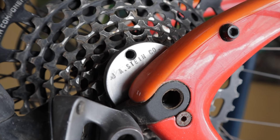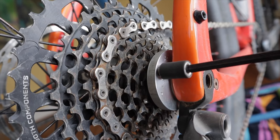Once that's all sorted, make sure the wheel is installed and tightened properly — the tool needs to sit flush and engage the splines evenly. Spin the wheel to rotate the tool until you line up where you'll want the pin to contact the frame. Make sure the pin's not going to rest on the derailleur hanger or else you can shear it off and really mess things up. The optimal position varied between my two bikes, so it'll probably be different for yours. There's also a chance this tool won't work at all with your frame, so you've got to test ahead of time. Jim told me people have had success flipping the wheel and using the tool on the non-drive side dropout.